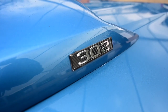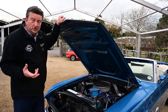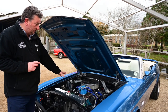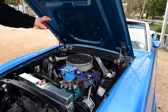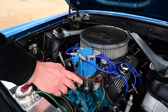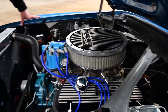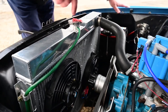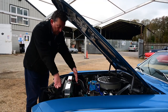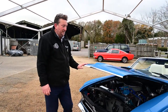Let's have a look under the bonnet — it's had a few nice upgrades, this car. As you can see, it's a 302 V8, which is one of the smoothest engines. What's happened here is it's had electronic ignition put onto it for reliability. It's had a four-barrel Edelbrock carb on it, along with the Edelbrock performance manifold. It's also got power steering and power disc brakes up there in the corner with a big servo, so stopping power is really good. To keep it cool, there's an alloy radiator with two fans, so if you're ever worried about an old car overheating, someone spent the money and had this beautiful rad put in. A great car, great performance, great fun to drive.